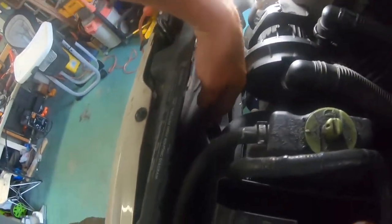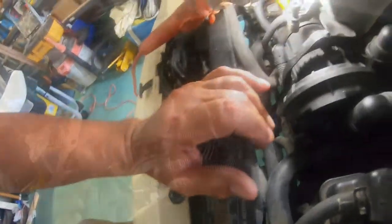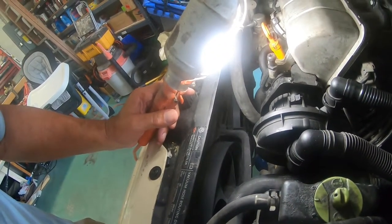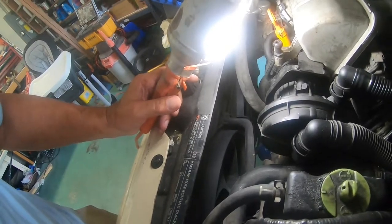Well, I came out that night, ran it for a good 10, 12 minutes, just idling — the fans would have definitely come on. And they didn't come on. They're turning freely. But fans are turning freely. So it makes perfectly good sense that the fan control module went up. And after doing a little bit of research, it's very, very common on these things.